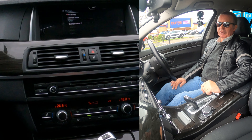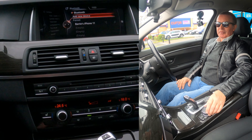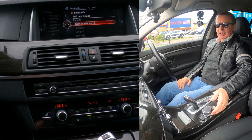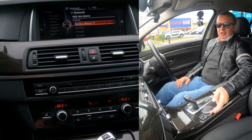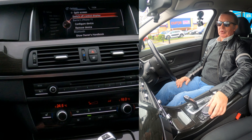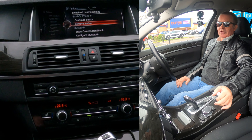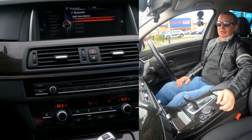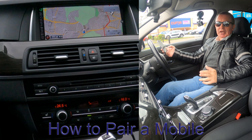Click Bluetooth menu and here you can see Bluetooth — 'add new device' or my phone, which is paired. There's a settings icon at the side, like a cog. Knock the iDrive across and that brings up a new display: 'configure device' or 'remove device'. Remove device — that's it, gone.